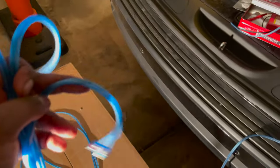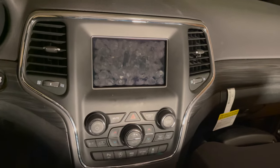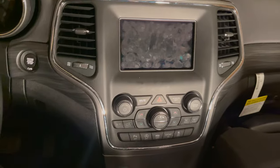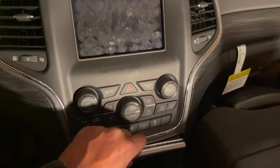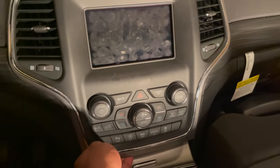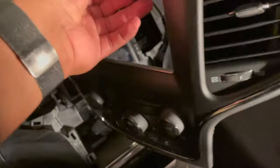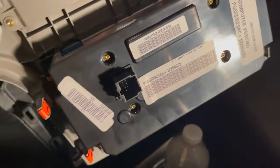Next thing is to run my RCA wires. I'm going to start from the back and work my way forward. Now I need to remove the radio and get behind it so I can splice into the wires to connect the amp signal to the radio signal. This car is really easy — you just grab from the bottom and slightly pull and the trim begins to pop out. There'll be one connector in the back — quick disconnect — put that to the side. Now you have the radio.